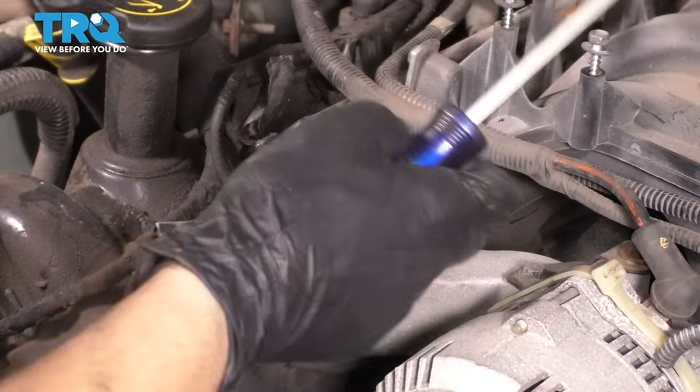The pump does have a little bit of play in the shaft here, and that usually helps with lining itself up. But for some reason, if you put it on too far or not enough, well, like I said, it'll squeal and then you'll have to adjust it.